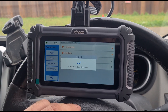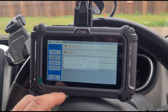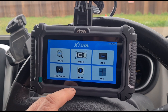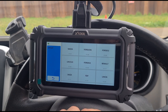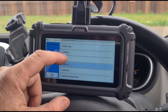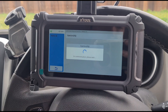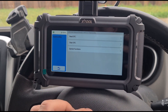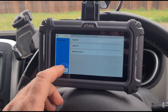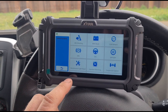Let's see what special functions we can find. We'll have a look at the ABS faults — invalid multiplex signal. Let's come back from there and see where we can find our special functions. Special functions here — DPF EGR. We're going to go Renault. It connected a bit quicker this time. I'm going to be looking for a Traffic — that's the one. Special functions: we've just got regeneration there for that. We don't want to do a regen, but you have got the option to do that. Obviously each different car would give you different options of what you can do, whatever it's compatible with.